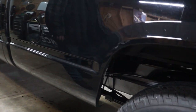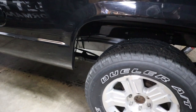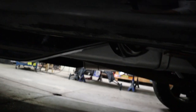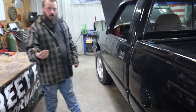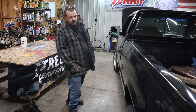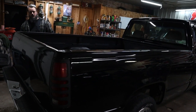I've never done any paint to the vehicle whatsoever. But underneath, the bottom of the cab and the bottom of the bed — sandblasted, prepped, and POR-15'd pretty much everything. It's clean. I used two chain falls tied up in some rafters to do the flip on the bed so I could sit up on top and actually grind it. New gas tank — I'm going to run a fuel cell at some point, but that was the cheapest alternative just to get it going. I used Fragola PTFE line for all the fuel lines and trans lines, and got all my adapters from Summit Racing. It's just a really clean truck, so now I got a nice platform — that's the worst when you're trying to build something nice and bust and rust. I spent a long time just busting rust on the bottom and getting it clean. That way I'm just worried about power now, not worried about rust.